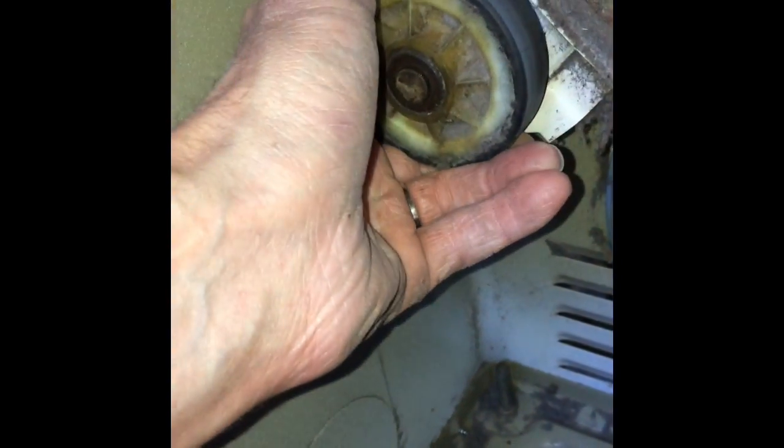And I noticed with this machine that there's a lot of accumulated lint in the cabinet, which is really bad. It's a fire danger. There's even evidence that there were a couple little fires in here previously, seen in the scorched lint. And also, it gums up the works. In fact, the lint had gotten caught between the wheel's shaft and the metal bearing and created a gummy type surface. It made it really hard to move.